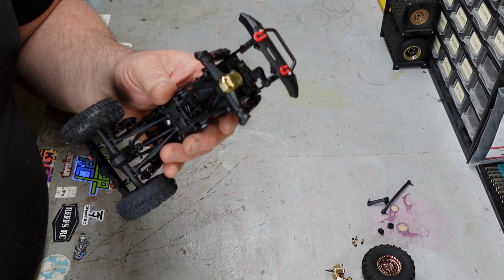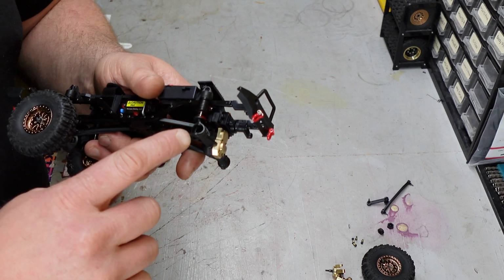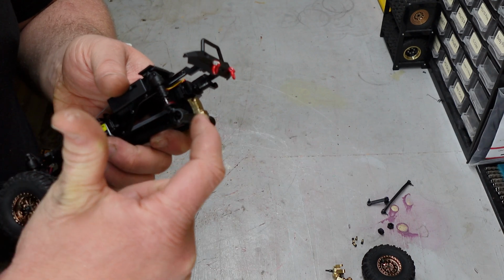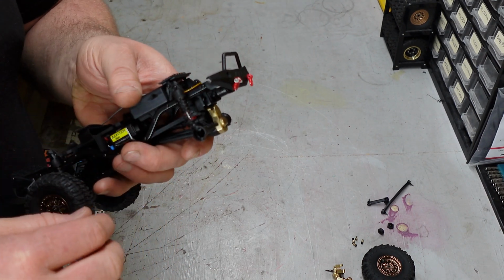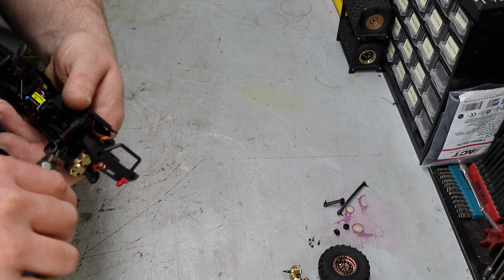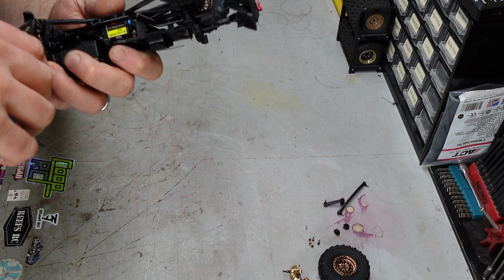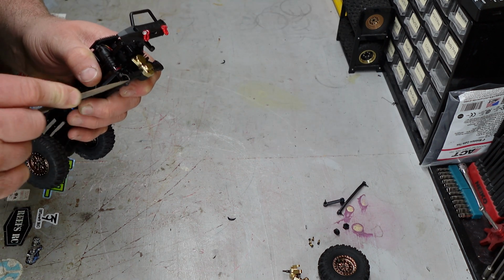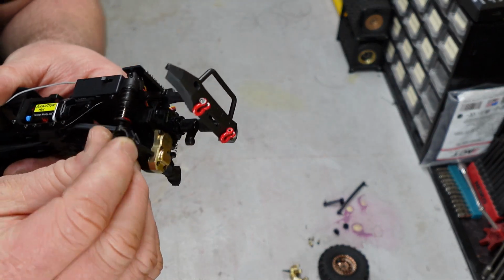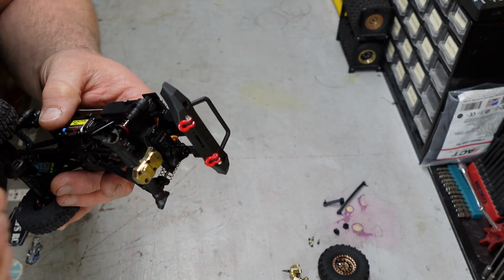I do have a full video on that. I'll make sure I leave a link in the description box below where you can check the video out. I'm not going to go into detail in this video because I already have one, but you're just going to want to trim these edges, this side and this side, just a little bit, just so you can get a little bit more steering angle so the knuckles don't hit it. This isn't no beauty pageant, so it's not perfect, but filed it down a little bit. So now they are nice and ground down so we can shove the axles in.